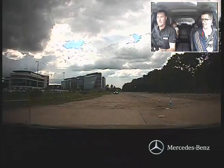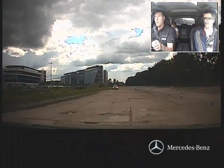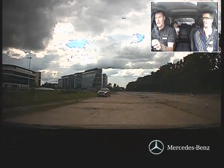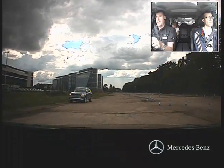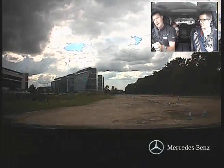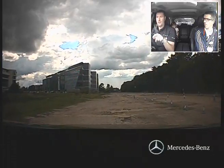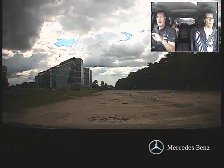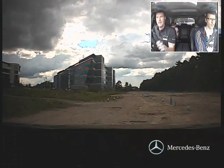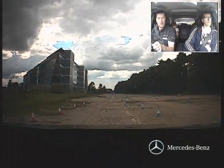So what can this, as a new car, do that the old ones can't? Well, there's one obstacle that'll take you over the V gully, which a traditional off-roader might struggle to get up, because if you haven't got enough axle articulation to keep the wheels in contact with the ground, and you can't lock all of the diffs to stop the power escaping from the wheels that have no grip, it becomes an interesting challenge for the car.